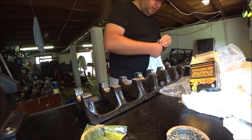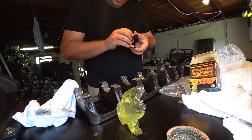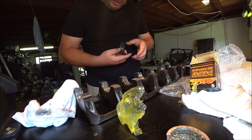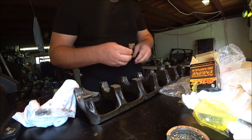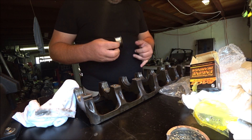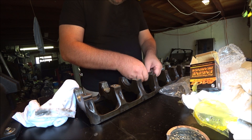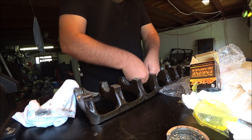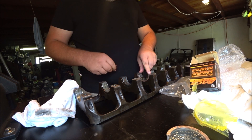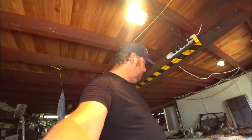That one there is a bit high on that side so push it down — sits into the middle. As long as you're very close they'll crush and center themselves against the other half, but if you're a long way out it could spell drama. Now is there a direction? Yes, there's a tang here, so this is your thrust bearing — goes on journal four.